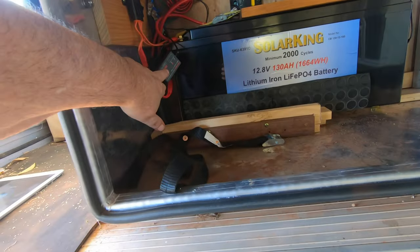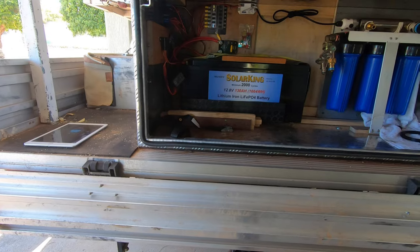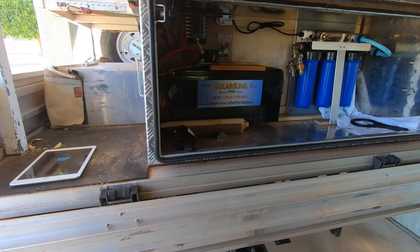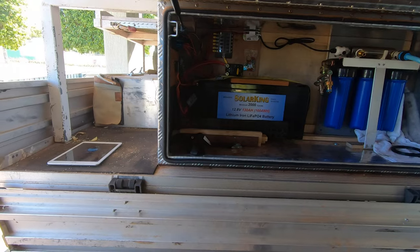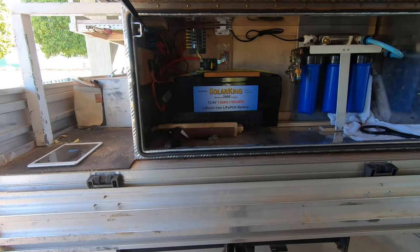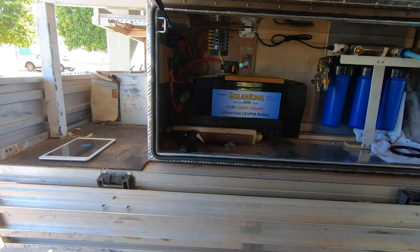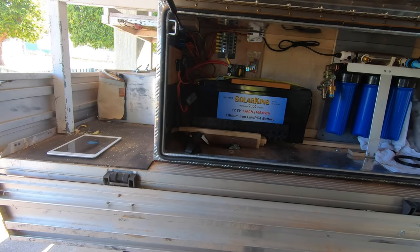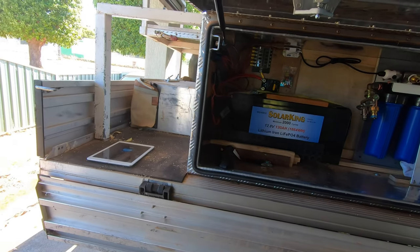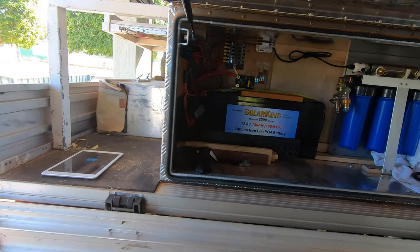Now don't worry about these, they don't use much power, okay? They're only Bluetooth, all right? But they do trickle power away, just like everything else does. Your clock, your security system, your satellite tracking in your vehicle if you have satellite tracking. Everything else that is turned on, we call it vampire loads because they just keep sucking. But that's no problem with most vehicles. It's no problem with mine. I'll put it in the sun, that can stay here for months and months and months and just charge with the sun. But for other vehicles, you just take them for a drive once a week and they're fine.